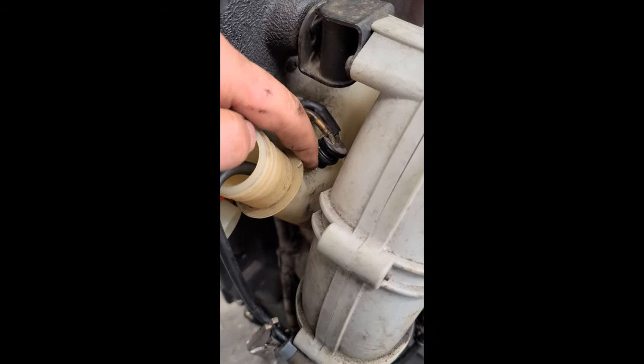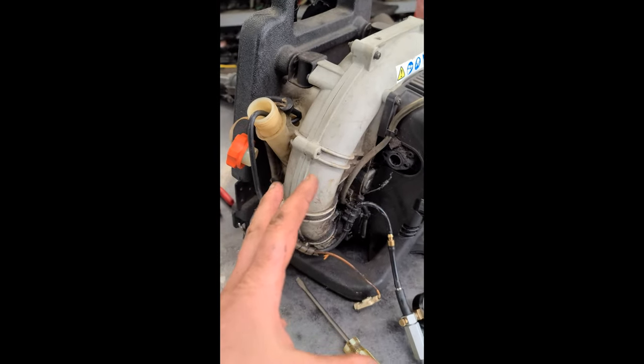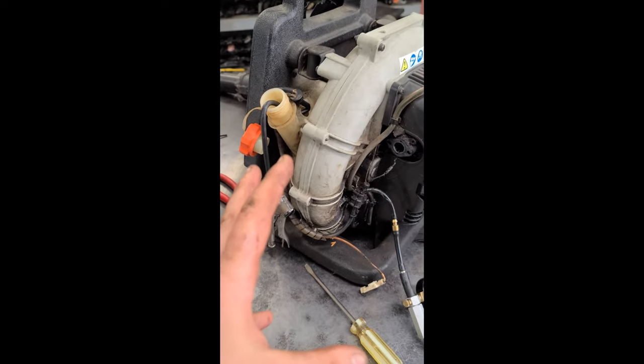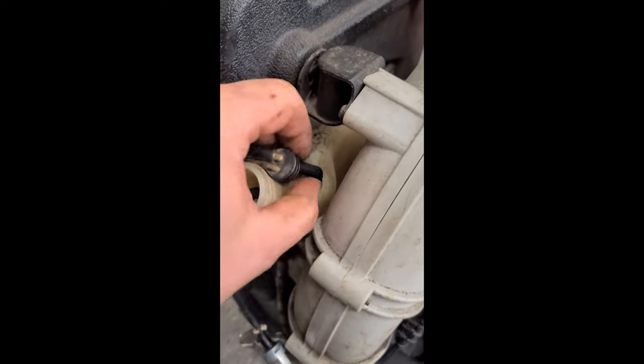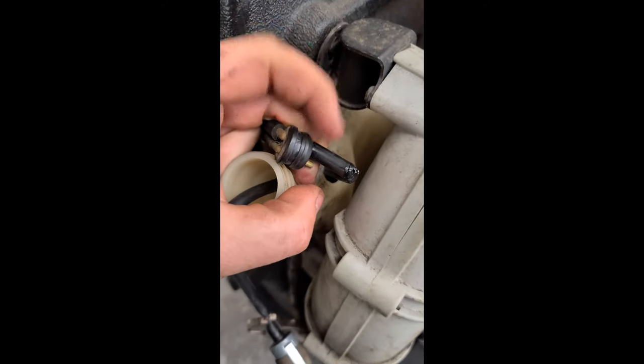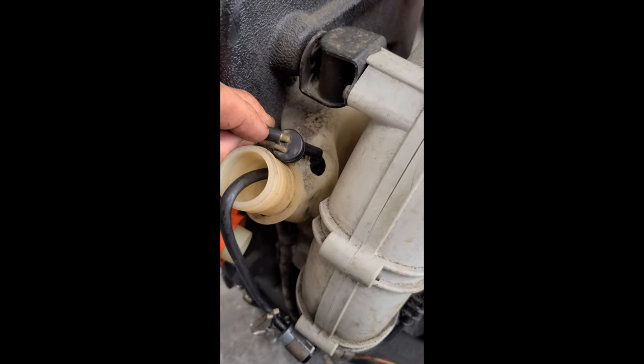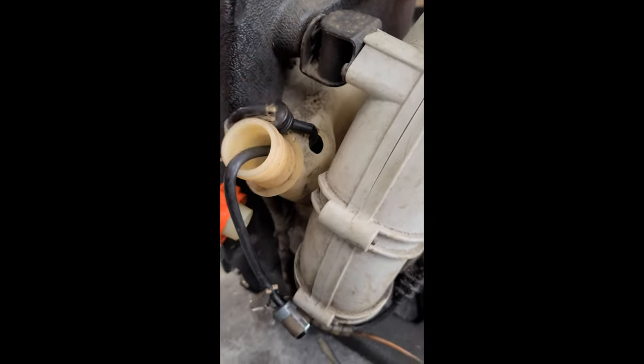Normally this grommet is inside the tank here with this fuel line. These machines often come into the shop and customers say it just cuts out or they can't get it going. Most of the time what's wrong is the fuel line right where it connects on the connector inside the tank — it'll crack right there.